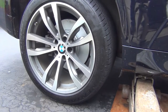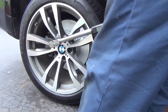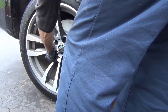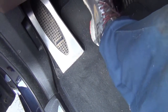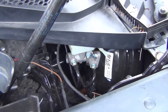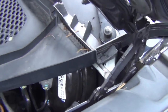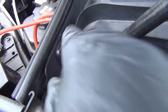Lower the car, and 140 plus or minus 10 newton meters. Make sure you always step on the brake after doing your brake job to seat the pads, and to make sure there's no air gap when you put the car in reverse — because otherwise you could go to the floor and have no brakes and hit something. Verify your brake fluid level is good and install the cover back on — you're just lining up the tabs, very easy. Then right here you have a push rivet, a plastic one — and that's all set.